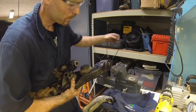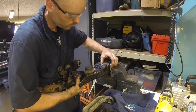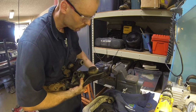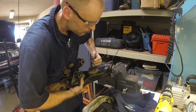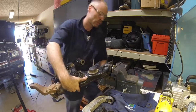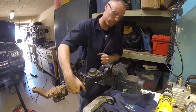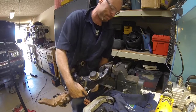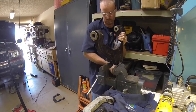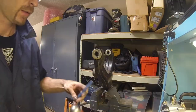Alright, now this time I used the vise to put the washer back on, which actually worked a lot better. You know, it felt more controlled. I wasn't hammering the washer back and forth or anything. It just pushed on without any drama. Once it was on the sleeve, then I used the punch and the hammer again to bend that little flange around the washer.